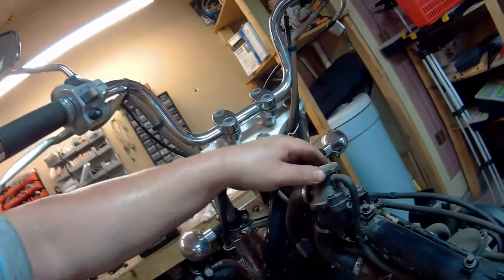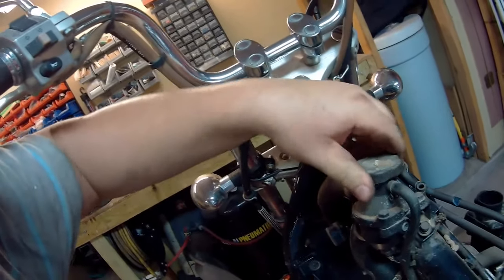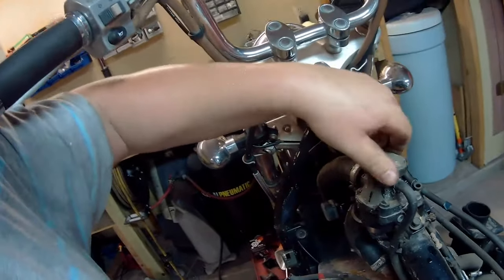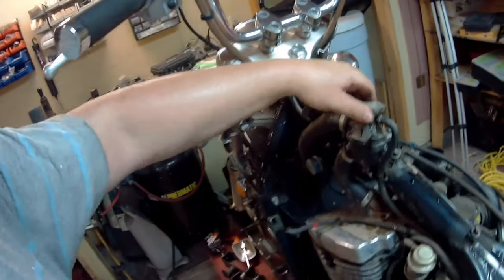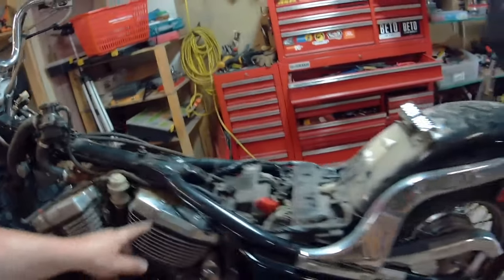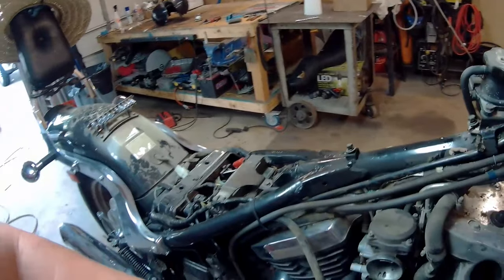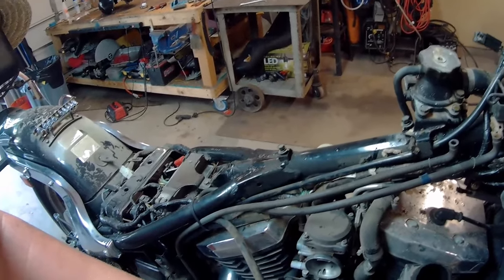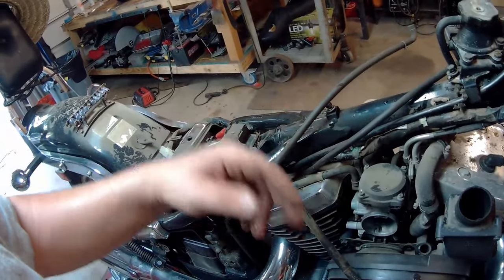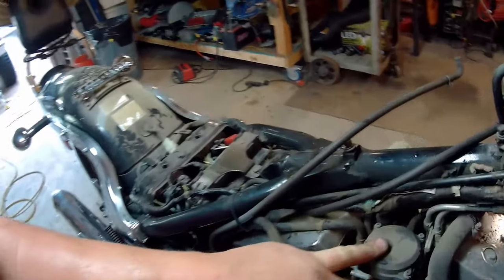This is our cooling system. We're going to take a peek at what's going on in here — solid green coolant. This bike's totally fine, don't have to worry about that. Basically our fuel feed is right here, it goes through that valley to this little carburetor right here. Whenever you're working on V-twin bikes, V-twin bikes with one carburetor are great because the linkage is easy — there's no synchronization. You basically just take this one carburetor off and rebuild it.